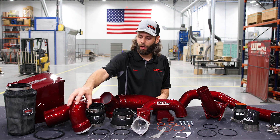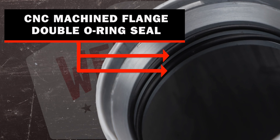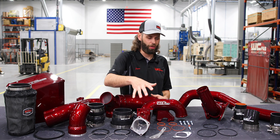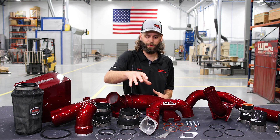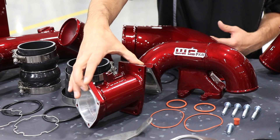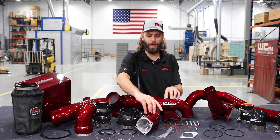Another benefit of our cold side pipe over the factory: the factory pipe uses a single lip ring style seal, whereas at the connection to the intercooler and at the throttle valve we use a double O-ring style seal and include new wire clips to replace any of those old worn out factory components. This intercooler pipe then connects to our three inch upper intercooler pipe and three inch Y-bridge assembly. This kit in front of us is LMM specific — the LMM uses a throttle valve whereas the LBZ is a direct connection. We use an O-ring seal to connect to that OEM throttle valve, and we have a map sensor port to connect your factory map sensor with a new map sensor seal. That lower component then connects to your grid heater.